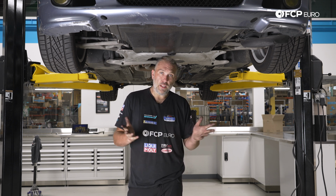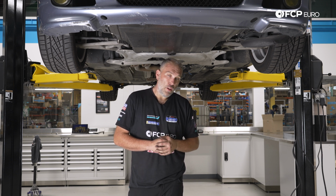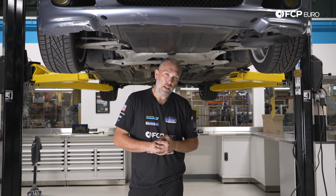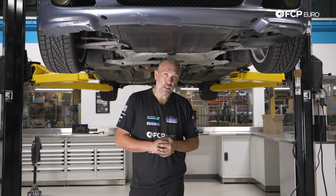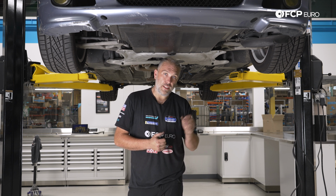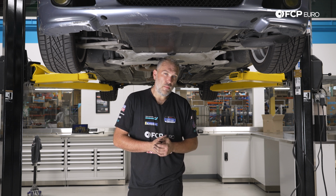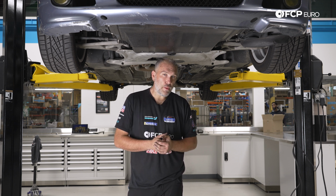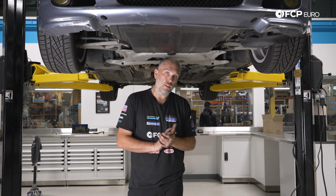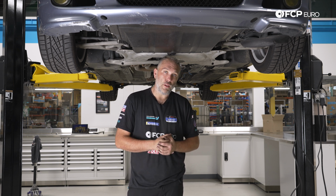The biggest thing is really going to be taking your time, measuring the clearances. Know that you're probably going to drop a shim or two while you're doing the valve adjustments, and that having magnetic pickup tools on hand to grab those shims when they fall into a really awkward place is going to be one of those things that you need. But past that, very straightforward, pretty easy to do, oddly soothing and therapeutic. But I'd say the biggest challenges again are taking your time, making sure that all the measurements are good, and making sure that you have consistent drag between both the intake and exhaust side when you're using the feeler gauges.